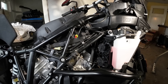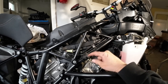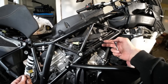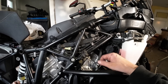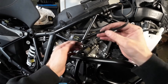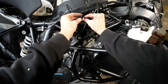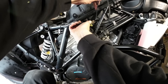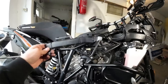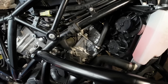Still in this area, there's another piece offending my sensibilities. I don't understand what purpose this cable loom guard actually has — all that is here is a petrol tank, there's nowhere the loom can go, it's sandwiched between the air box and the frame. There are plenty of other places with a couple of cable ties that could hold it tight, so that's got to come out. I'll now put a hefty cable tie around that bunch, another one around the next, and a slightly smaller one around the bit in the middle. Everything is firmly in place, nothing's touching anything, nothing's flapping — and of course the removed bracket and its two screws find their way into the bag of weightlessness.